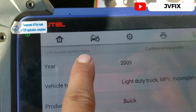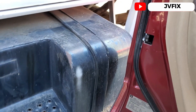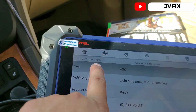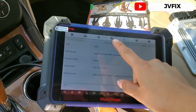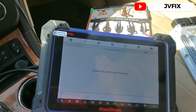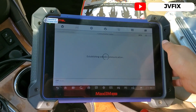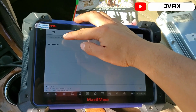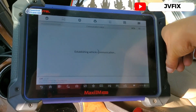The used computer shows bin 0322, but the bin I need to program is 0324 — it doesn't match because it came from a different car. Let me go to the diagnostic interface to show you that the module has a different calibration. We'll hit Diagnosis, Control Unit, Engine Module, and ID Information to communicate with the computer.